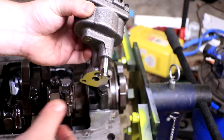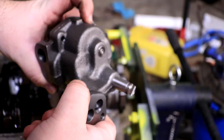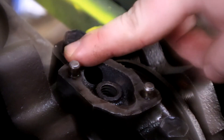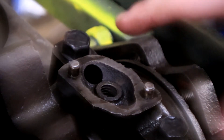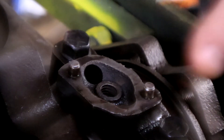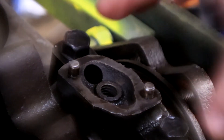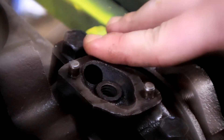To start off, let's get you familiar with what the oil pump looks like. On this Chevy 350, it looks like this, and it connects right here on the main cap for the crankshaft. And that brings us to the first problem you might encounter. These little pins here might not be aligned perfectly, and that's okay — that happens a lot. If your main cap gets moved or damaged or anything while you take it out, there is a very high chance of it happening. Thankfully, I was super careful with this cap when I took it off and when I put it back on.